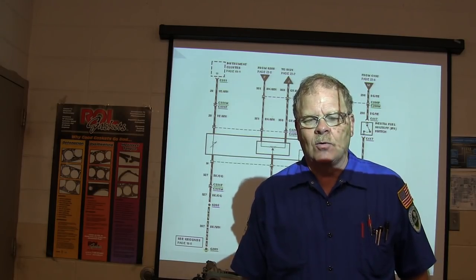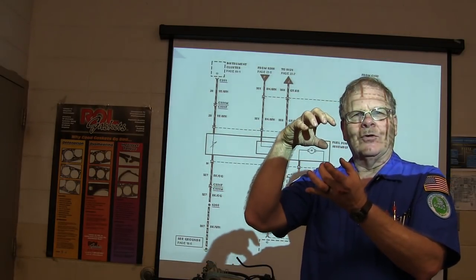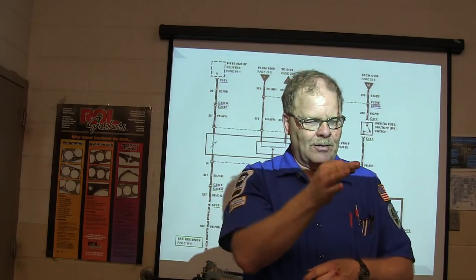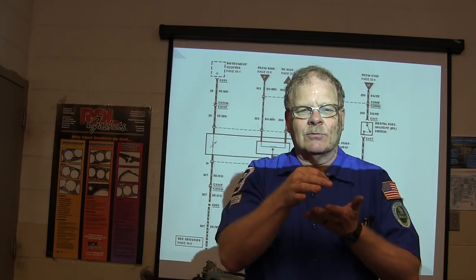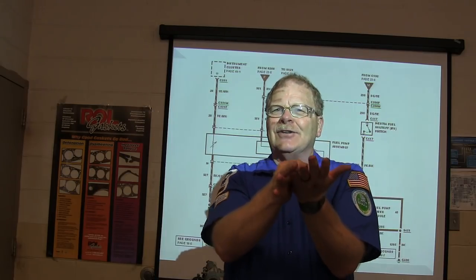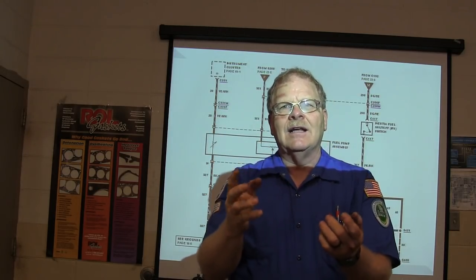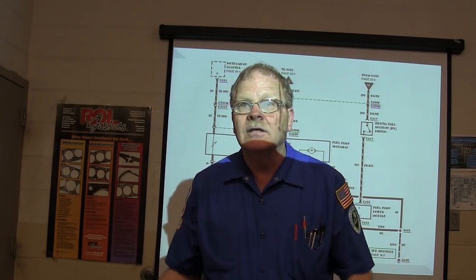What I found out was somebody had put a fuel pump in it, and you know the sock that's on the bottom of the fuel pump? They had knocked it off when they were putting it in, and they just went ahead and put it in there anyway. The round part of the pump where the sock was supposed to be was just a naked hole. Whenever you would stop, the gas would slosh and it would clog up the pump. When you backed up, it did the same thing. I put a fuel pressure gauge on it and noticed when I stopped, the fuel pressure would fall far enough that it stalled the engine. And when I backed up, it did the same thing. That's when I realized gas sloshing was causing that. See what I mean? Sometimes it's just common sense, basically.